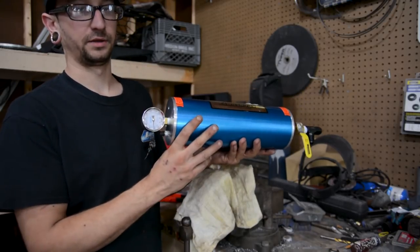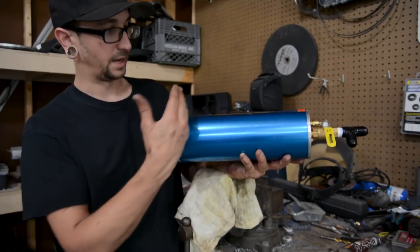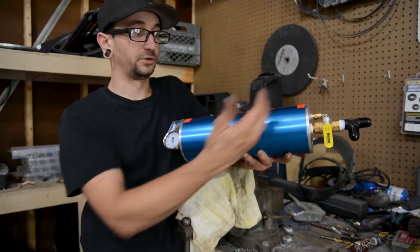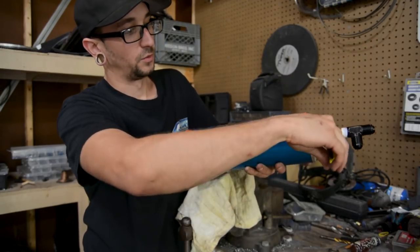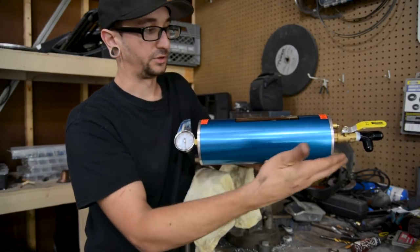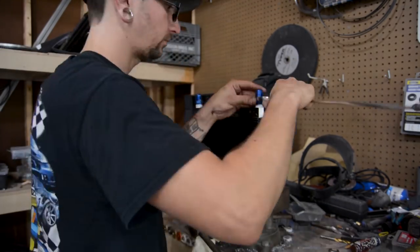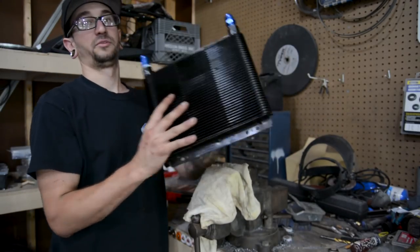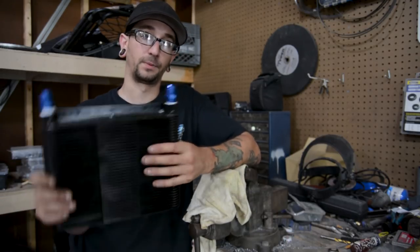We also clocked our air gauge on the side. The air gauge is to pressurize the back of the piston — that's for when the accumulator fills up. If you lose oil pressure on this side, when you open the valve up you're going to have at least some air pressure to push that piston out and you can pre-lubricate the engine. Since we're installing fittings on everything right now, I'm going to go ahead and install the fittings onto the oil cooler as well. Now that we have the fittings on the AccuSump and on the block adapter, we should be pretty much done with prep work.